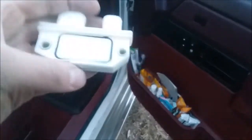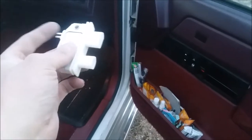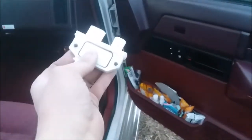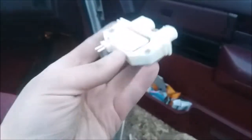There are two plugs that go to the wire harness to your ignition control module. I've actually got a spare ignition control module sitting on my seat right now — this is what your ignition control module looks like. That is something that you will have to replace if an EMP were to happen. Your engine will not run if you do not have one of these. I had to replace one of these, and I accidentally didn't have one of the wires hooked up. I tried turning the truck over and couldn't figure out why it wasn't working — I hadn't gotten the little pigtail on the back end connected.